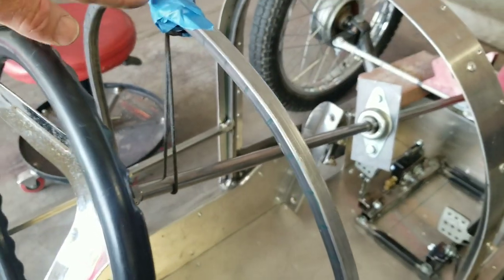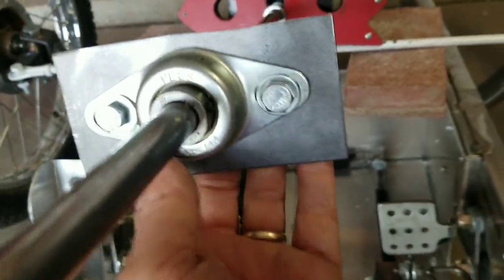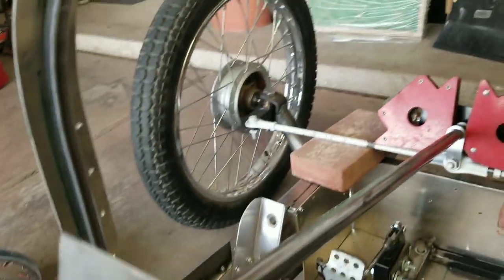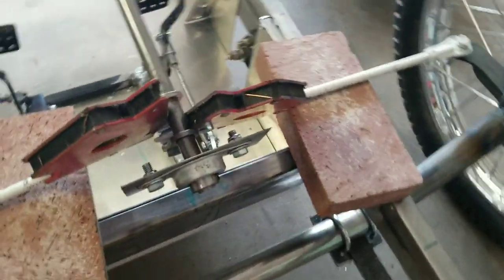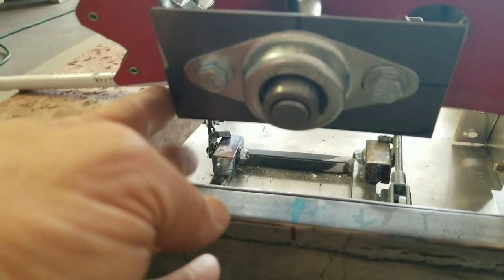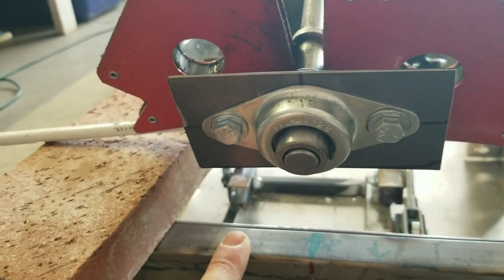I'm mocking up the steering column and clearancing it. I've got six inches of clearance from the top of this crossmember to the top of the steering column. That seems to work pretty good with the body line and the steering wheel — that's just kind of sitting on there right now. The bearings are mounted to a plate I drilled out, so this is going to slide up here. I want to rig up a bracket to attach that to the frame, and then down here at the front, same thing. I've got some bricks and magnets just kind of holding everything in place.